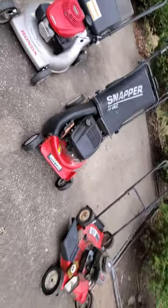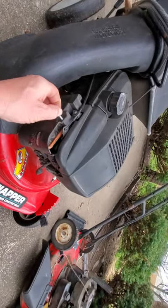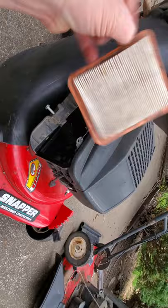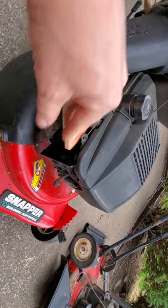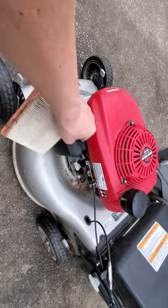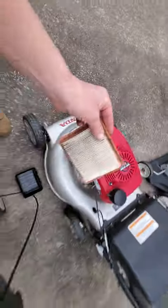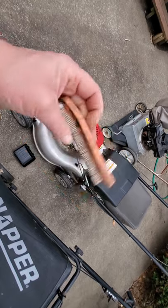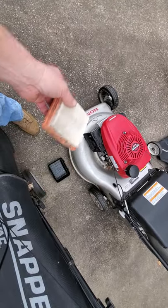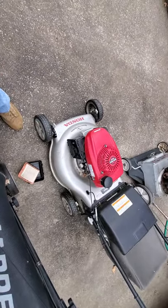So that is fuel delivery. We checked for a dirty air cleaner. On this lawnmower, to get to the air cleaner it's a regular screwdriver to pull this out. These are very common air cleaners - the plastic part goes toward the engine side when you put it back in. You want to check these because if this gets totally blocked with debris, it'll completely block the air, which will give a really rich mixture and send excessive fuel delivery to the combustion chamber, fouling the spark plug so it won't run.